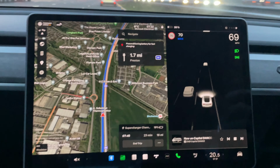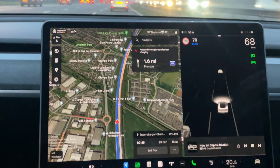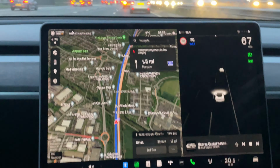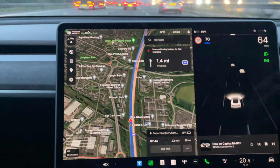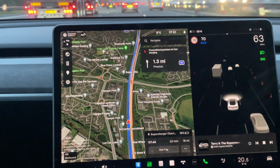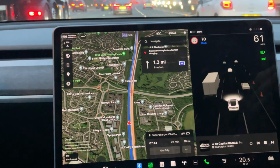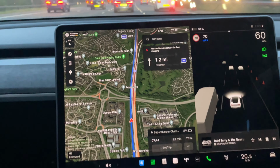Because I've put such a far away destination in the settings, I've let the car do the thinking. It will find the supercharger stations automatically, as I mentioned earlier, and when it knows that I'm getting close to one that it's chosen, it will start to precondition that battery. So early on in the early hours of this morning, I was about 40 minutes away from the charger when it started preconditioning. The car was just on its first leg of the day, so the whole car was cold.